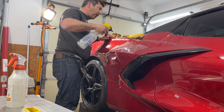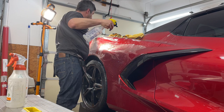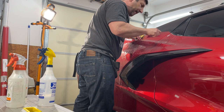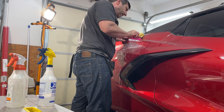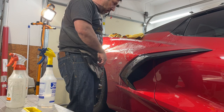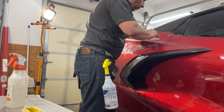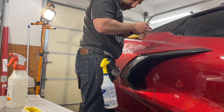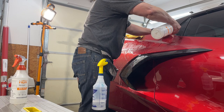I've got it set up where I want it and I'm going to tack this part up here, but I generally don't use tack solution initially on a big panel like this. So I'm just going to place it where I need it and start to squeegee. It helps if you keep the surface really wet — that way your squeegee doesn't stick, because if it sticks you get what's called chicken scratch or chicken skin. Up towards the top is where I use that alcohol solution, so I just put a little bit of alcohol up there.